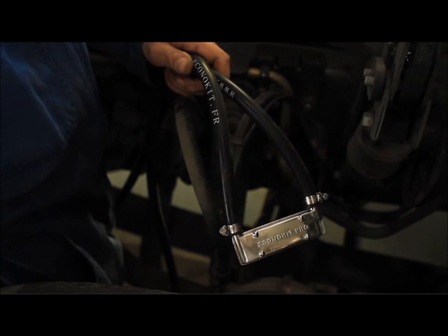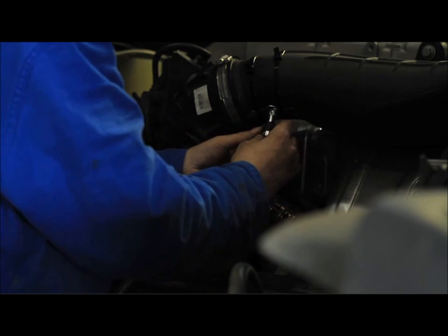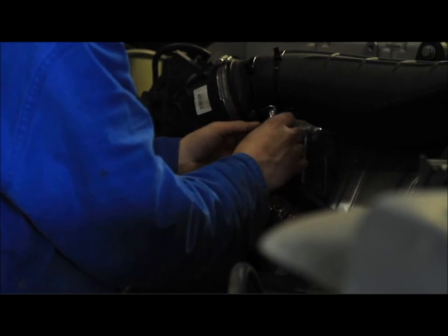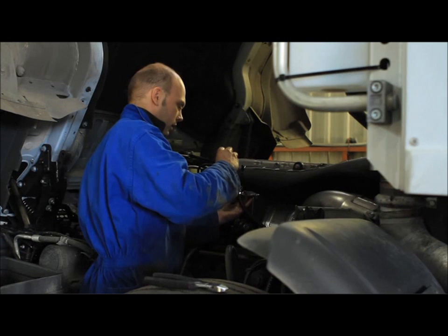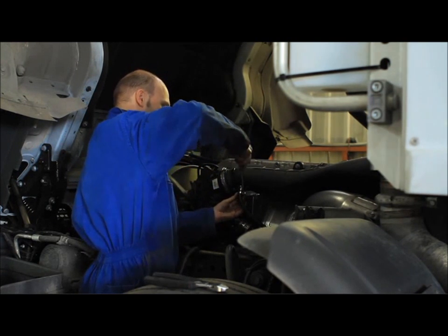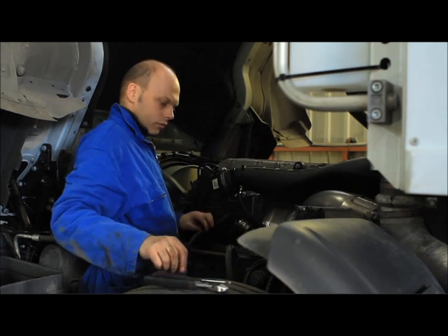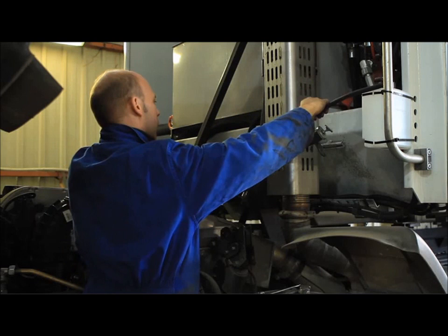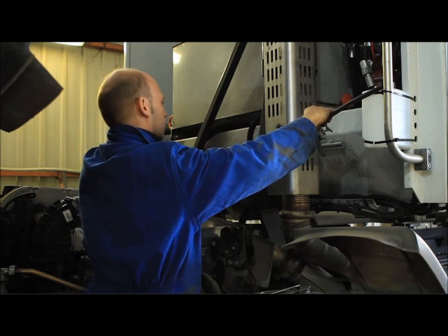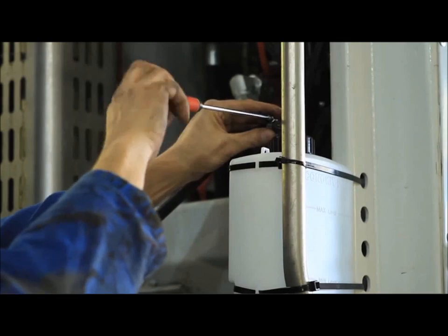No error possible. Link the silicone tube to the diffuser, making sure there are no low points in order to avoid accumulation of condensation when the engine is not running. Verify that the tubing in general does not rub against any sharp parts. Attach in place if necessary. In the same manner, connect the silicone tube to the reservoir and fix the hose in place with a metallic collar.